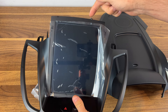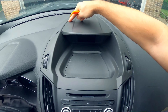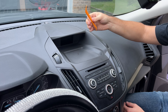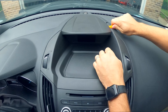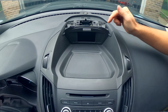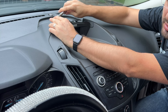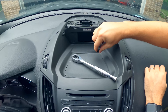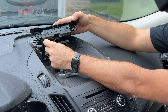We're going to start by disassembling this entire piece of the dashboard. First we remove the top plastic piece — I'm using a plastic trim removal tool to avoid scratching anything, but it should just pop off. It seems solid at first but it comes off. Next we remove two screws — one here and one here — they are T25 Torx bits.